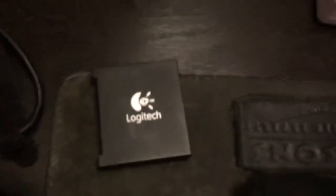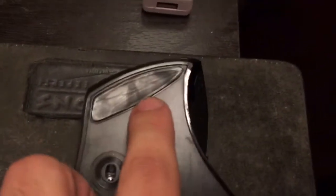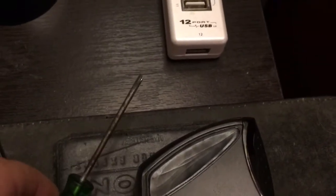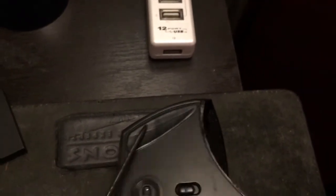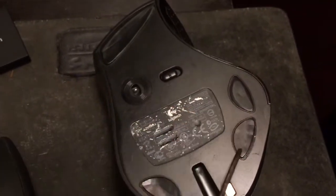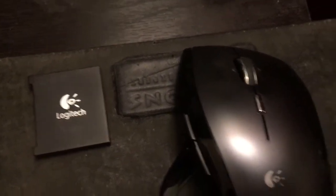It means the battery is dead. So I bought a new battery and opened it up — it's very easy. You take this little pad out, use a tiny flathead screwdriver. There's one screw underneath each pad, then you open it up — be careful, there's a wire there — and you just replace the battery underneath.